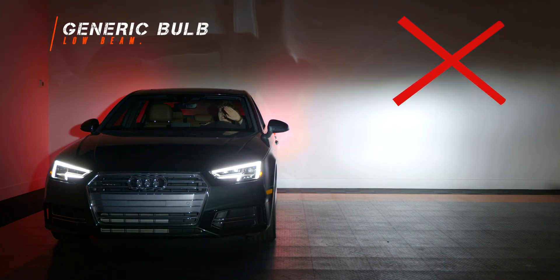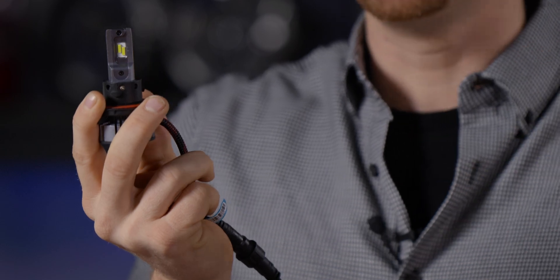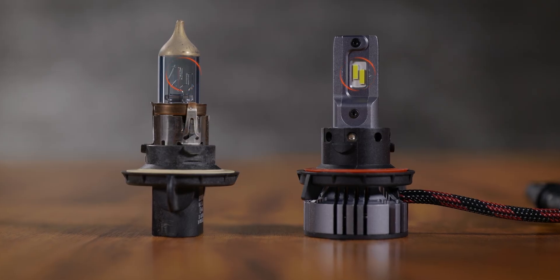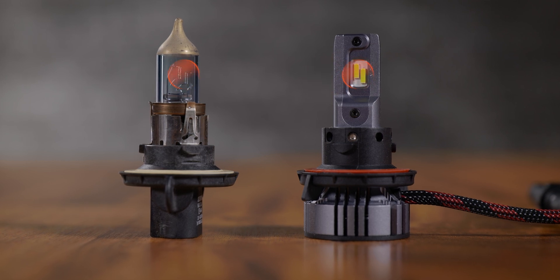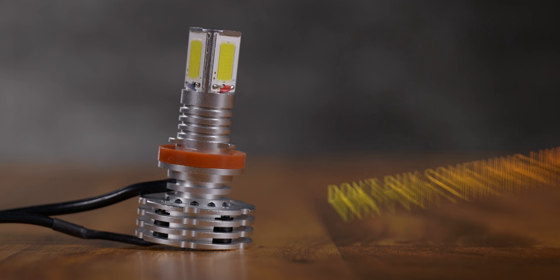So what you need to look for when buying an LED light — you need an LED like this one, this is the SV4 — that has the LED chips in the exact same spot as those original wire wound filaments. If there are a bunch of LED chips on it, like a multi-sided bulb you see off Amazon, it is going to scatter the light when you put it back in this headlight housing, and you're just going to blind oncoming drivers. It's not controlled, and it's the last thing you want when upgrading.